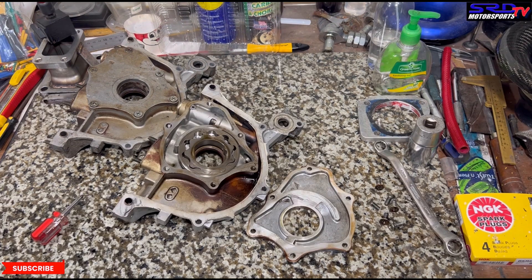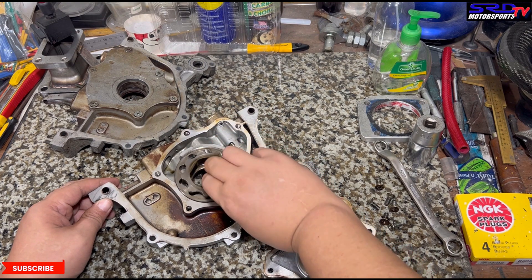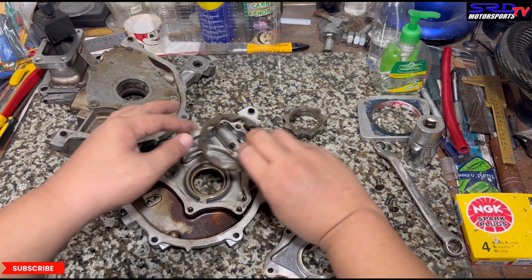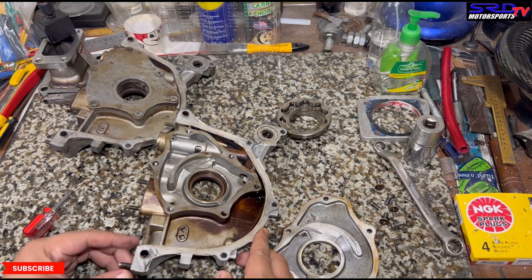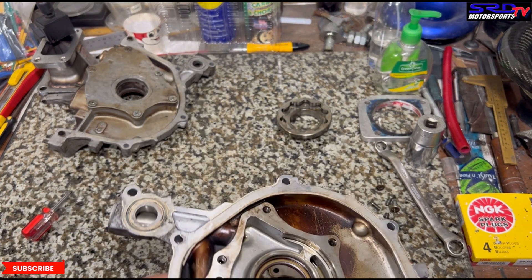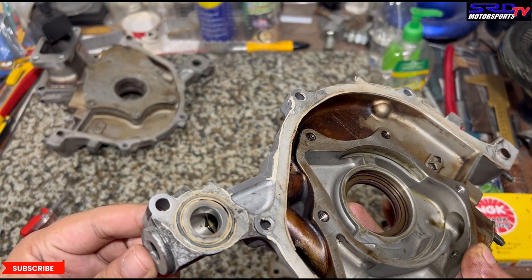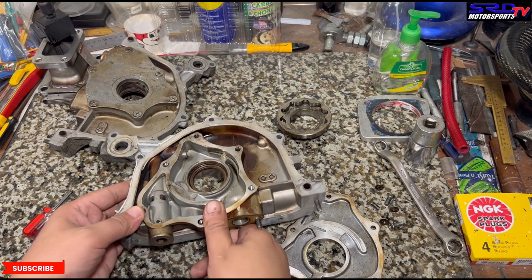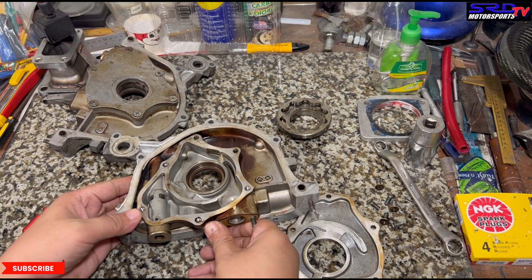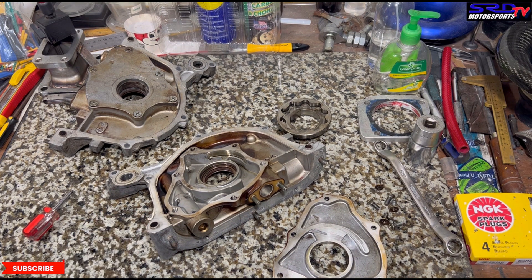After getting the clearances correct, porting is next. A lot of people port it without setting the clearances first — that actually lowers pressure, and that's when people say they need a new oil pump when they don't. You port that opening kind of like a velocity stack entry to make it efficient, and you remove the corner so the turn becomes a lot better. For example, Ecu Laters' B20 running since 2017 revs to 9700 RPM — it's not even ported, but the clearances were corrected. Same with my all-motor D16 B6 — not ported, just clearances set. That's what blueprinting your oil pump means.